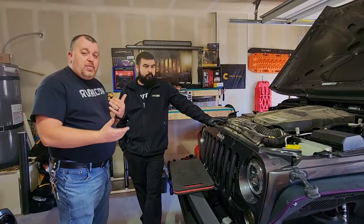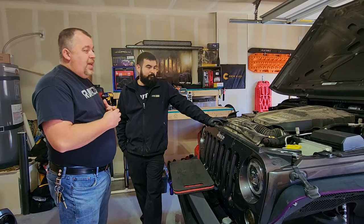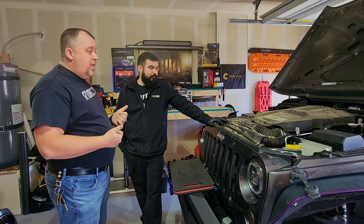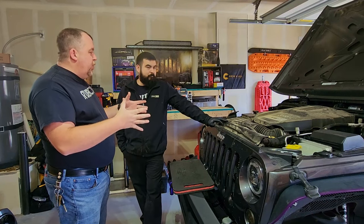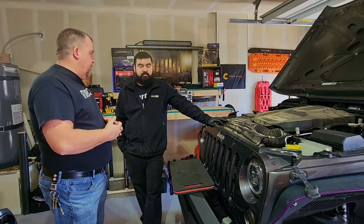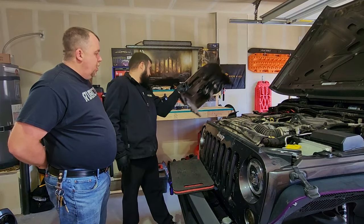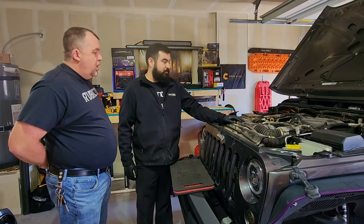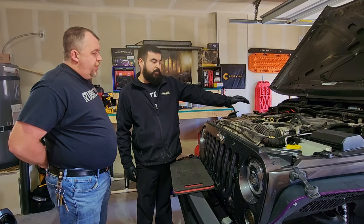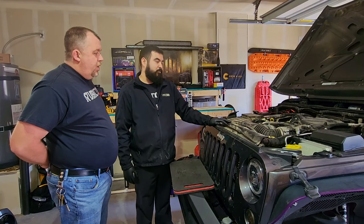All right. Since we have a special treat of having Marco with us today, and he is an ASE certified Jeep mechanic, we're going to let him take the reins here. So, Marco, explain an overview of what we're trying to accomplish. So what we have to do is replace the oil cooler. And the oil cooler on your Jeep just so happens to be under the upper and the lower intake plenum. So we have to take those off to be able to replace the oil cooler.